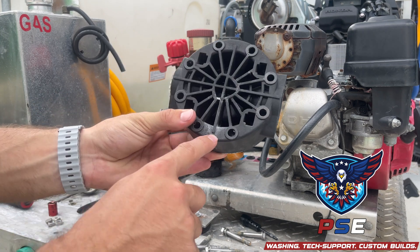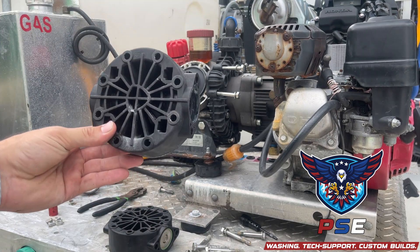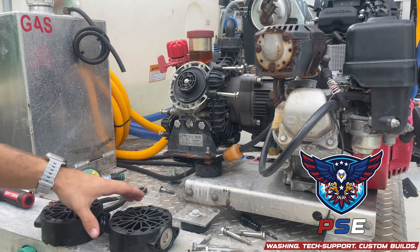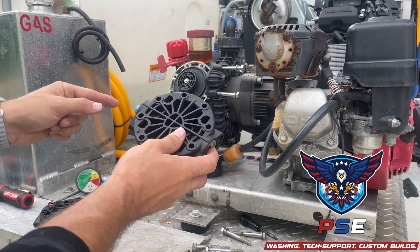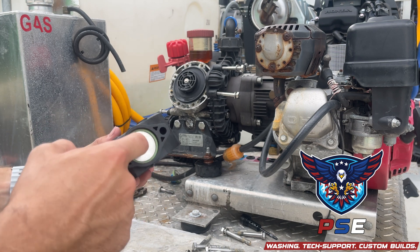On mine, the numbers down here at the bottom where the part number was were facing towards the ground. Now that we have this off, you've got to pay attention to which way the check valves are in here as well. This is the new one — on this side of the manifold, the check valves point out this way; on this side, they're recessed in here.